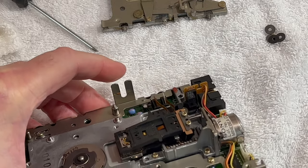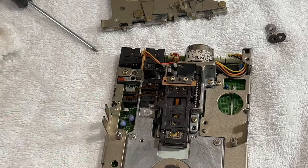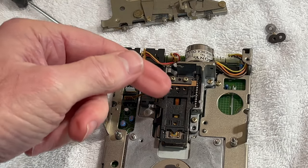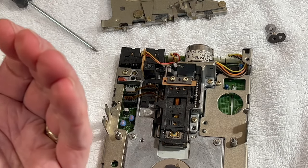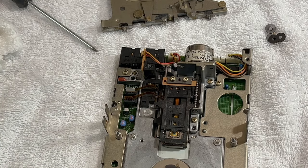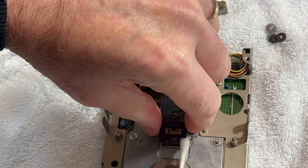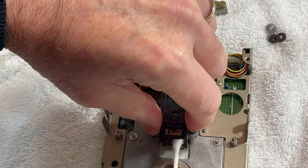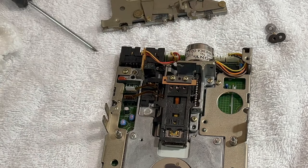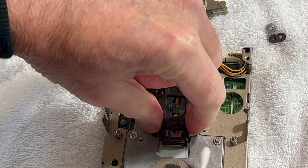There's a word of caution: there's a copper plate in here that serves as a spring, and there's also a tensioner — another spring underneath it. You just want to lift this up just enough to where you can get a Q-tip in there. You don't want to overextend that spring, because if you do, the heads won't close. So we're just going to clean the heads — just enough to get the Q-tip in there. Now we'll get a dry one. All right, that's good.